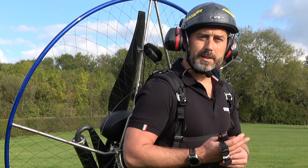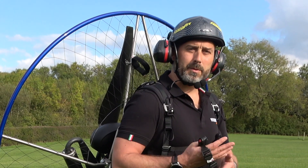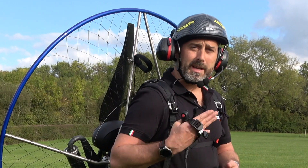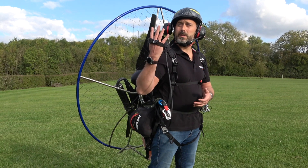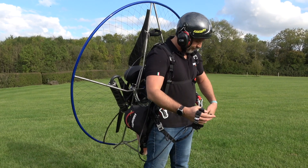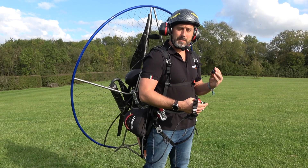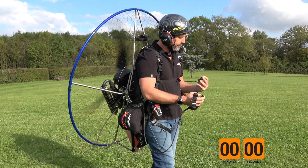So now we're going to complete the cycle practically. I'm going to start the engine, build up to 4,000 RPM, maintaining for the first four minutes, and then repeat the remainder of the cycle until completed. Clear prop. Using the tachometer we'll start to monitor the engine RPM. Brace — let's start the engine.